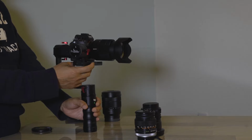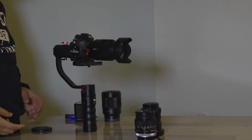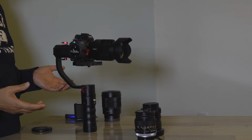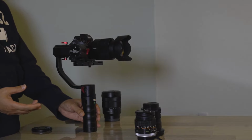Gyro calibration is done by pressing the menu button in 2 times. During this calibration process, the stabilizer must not be touched or subjected to any vibrations. This can cause miscalibrations in the gyro. Calibrating the gyro will solve issues regarding the level of the horizon.